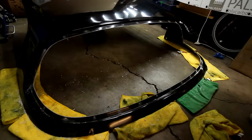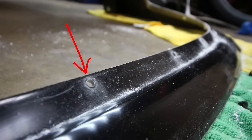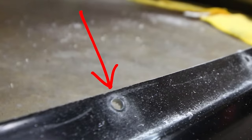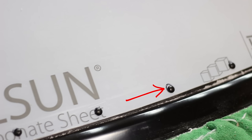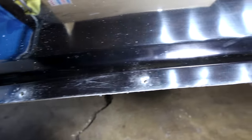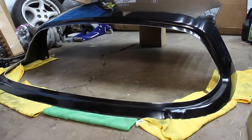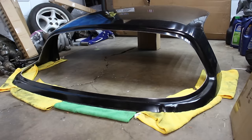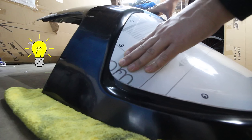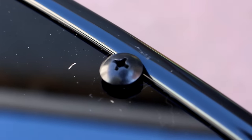If you do need to re-drill anything, make sure you don't re-drill the window — you're only drilling a new hole in the top itself. Just use the hole that is already in the window as a guide and then put the new hole into the fiberglass. Once I got everything drilled, I put the nuts on the very outer bolts just to hold the window in place so I could give it a visual inspection. The slight mistake I made is that some of the bottom holes in the fiberglass shell were getting close to the edge of the lip the window sits in. My solution would have been setting the top down, setting the window in, and putting a bright light underneath the top shining outwards so you can see the lip through the window as you're drilling and make sure you're not getting too close to that edge. If you drill the hole too close to the edge, it interferes with the trim you'll be putting on later.